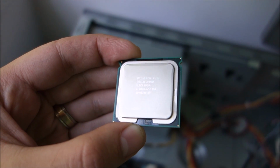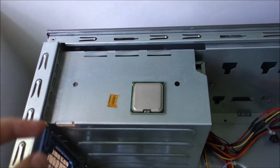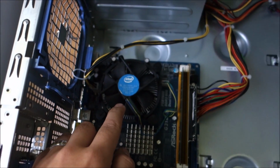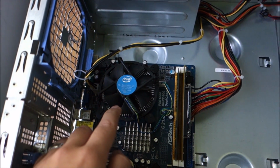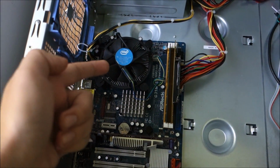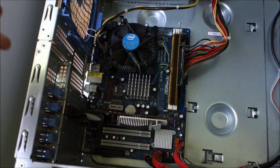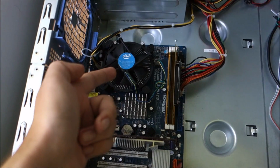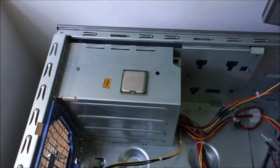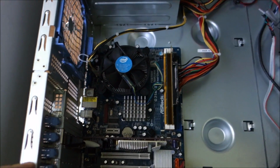Hopefully you can see it, and hopefully I can even overclock it a little bit by the FSB. Not really sure. This one, for example, it's overclocked to 2.2. It didn't want to overclock much. Another one I managed to cut it on the same motherboard to get it to 2.7. So this one only 2.2. This one is 2.5 to start with. Maybe 3 GHz. Yeah, that would be nice, but we will see about that.